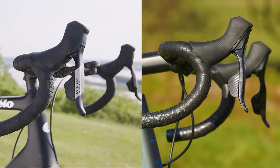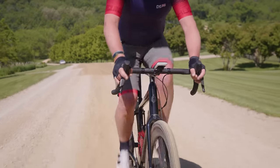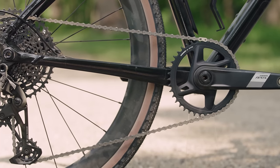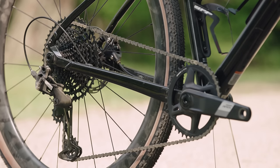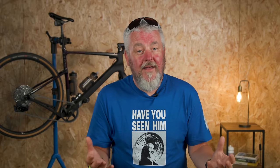Now Apex has had a complete redesign, with the shifters moving more in line with the current Force and Rival AXS designs — we've got videos on both linked in the description. It still works in pretty much the same way, with one paddle on the right-hand shifter taking care of both up and down shifts. The internals have changed to account for the extra cog on the cassette and ergonomics have also come in line with SRAM's latest stuff. SRAM told us they'd never given up on the humble cable-operated shift — it was just a case of electronic groupsets taking up a lot of their development time.